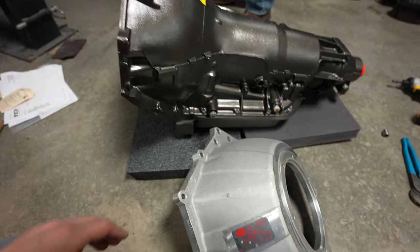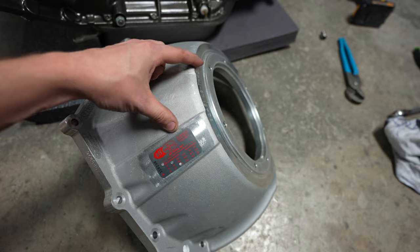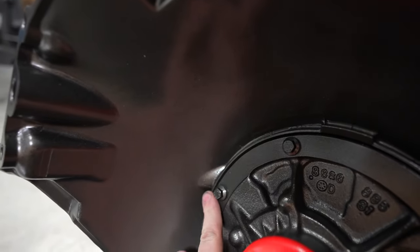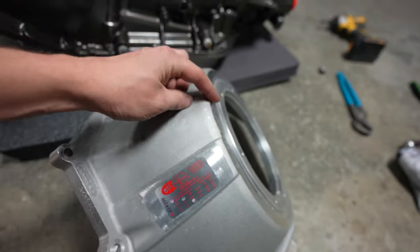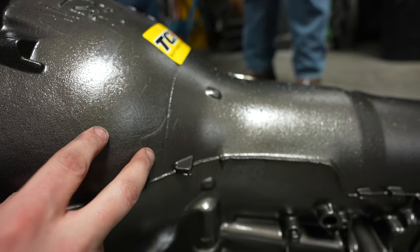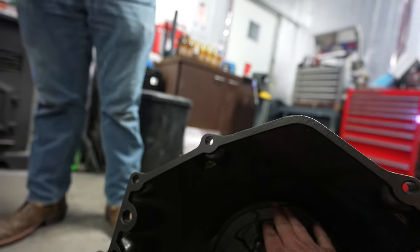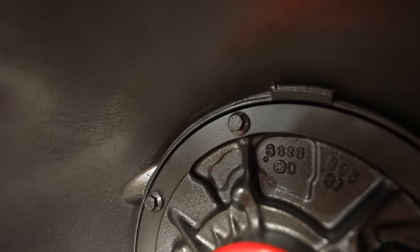Alrighty, so looking at this thing, you have this little lip. This bolts to the pump. Then you have a little bit of an air gap here that you'll want between it, so this doesn't necessarily hit the case. So I pretty much just need to cut the bell just past, almost even with the pump, because if it's flat even with the pump, then this bolts to the pump, and I got that distance that'll carry the gap all the way up through there. So about a quarter inch past this line, I will cut just in front of that, and then if I need to, I can sand back, but I think we'll be fairly close. I definitely don't want to get back into the pump either, so gotta be careful. I want to be just about a quarter inch on this side of that.